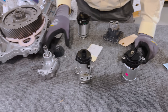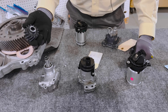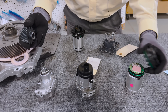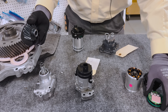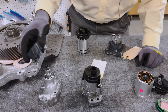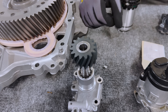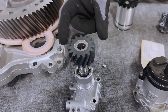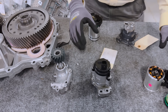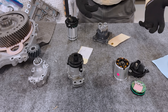A mechanical oil pump, instead of having an electric motor to drive it, just uses a gear. That's where the big cost saving is. The gear is less expensive than the windings, the magnet, and the electronics. So the benefit of the mechanical oil pump is that this gear ends up being less expensive than the electric motor.